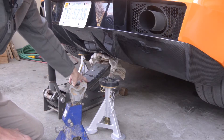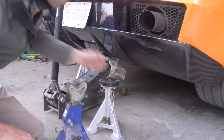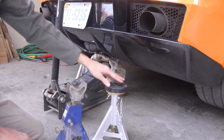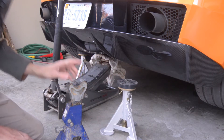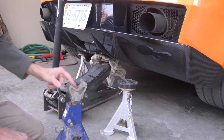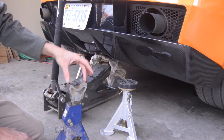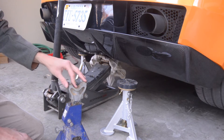First off, I recommend jacking up the car using a low profile jack on the beam that runs transverse to the length of the car right underneath the transmission. We're going to use a set of flat top jack stands — I'm going to link these in the description for you. I really can't recommend that you use a set of jack stands designed for pinch welds, because this will cause stress concentrations on the aluminum monocoque that this car is designed for. It might damage your car.